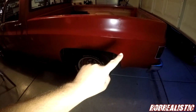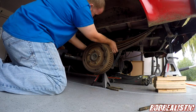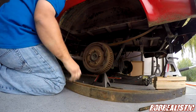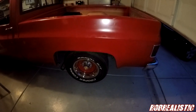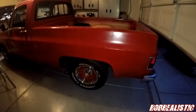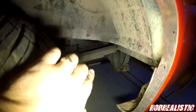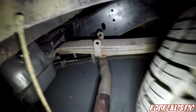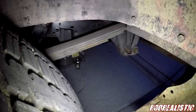When I tore all this stuff apart and pulled off the bolts, the leaf springs underneath are completely shot. They were torn apart and springs were removed — this side has four leaves, the other side only has three, and the truck leans to the right. I had to put it all back together to get the truck rolling again, and it does drive fine, but I didn't feel comfortable driving it knowing the leaf springs aren't held together properly. There's nothing holding them front or back — one bracket here on this side, and the other side doesn't have any whatsoever.